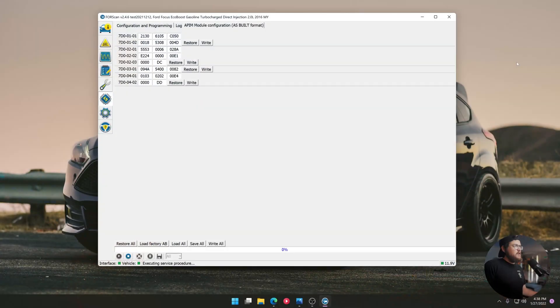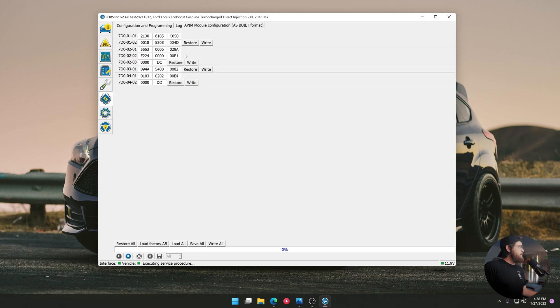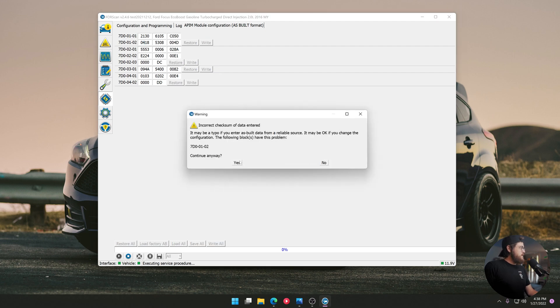Pretty much what we're going to do now is enable navigation inside FORScan. We're going to go into FORScan — we're already connected to our vehicle. This is the screen you'll be on once you connect. You can go down to Configuration and Programming and hit the Play button, then click OK. What I need you to do is hit the number four — we're going to change the second digit of the second line of the first set of blocks to a four. That's going to turn on our navigation. We'll click Yes, and we'll see Sync reboot. There's just one more thing we need to do to get maps working on our Sync 2 display.